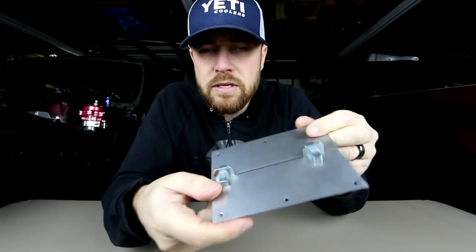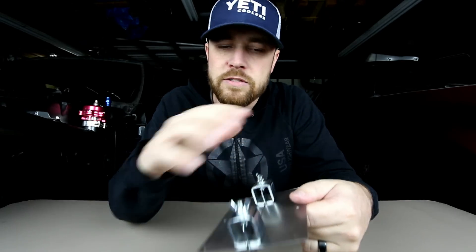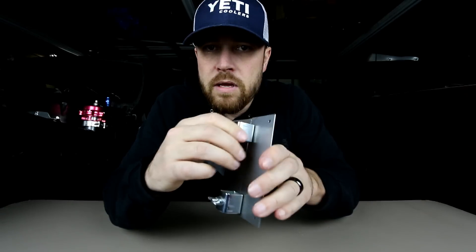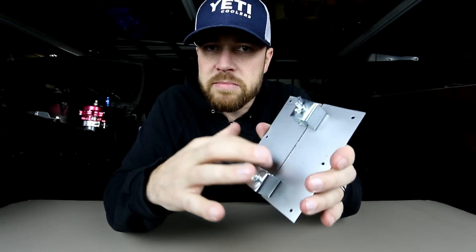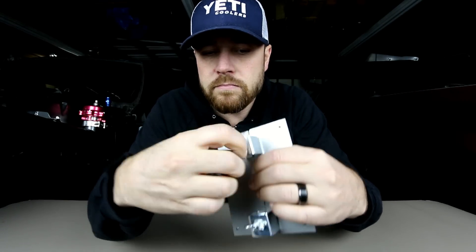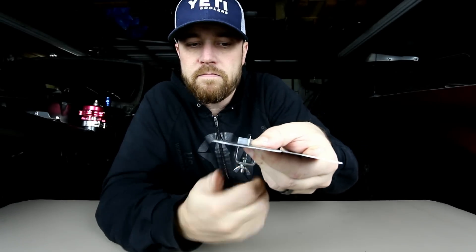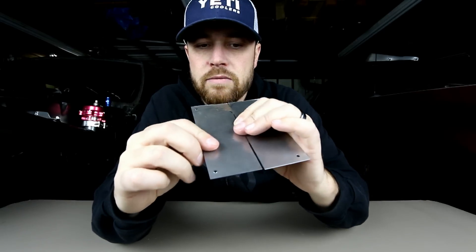Say this is the top side of the panel and there's the bottom side. You can fasten these to fit it, and then if you need to make an adjustment you can undo them, pull them apart, put them back together, so on and so forth. Once you get it to where you're ready to weld it, tighten everything down, put some tacks in here, and then all you have to do is loosen the front side. The actual blocks can slide out the bottom, and the butt clamp itself will fall out, leaving your panel nice and tacked together with a flush mount.